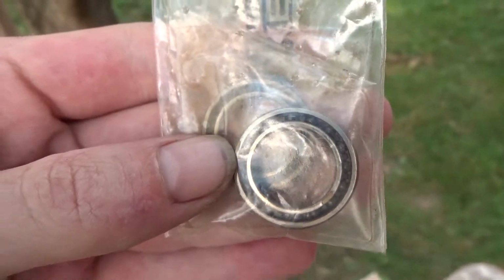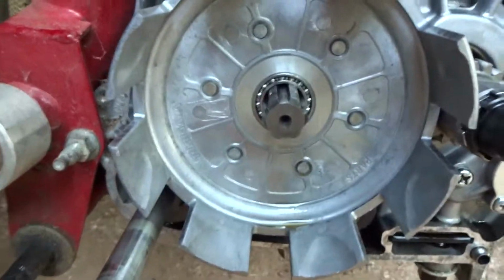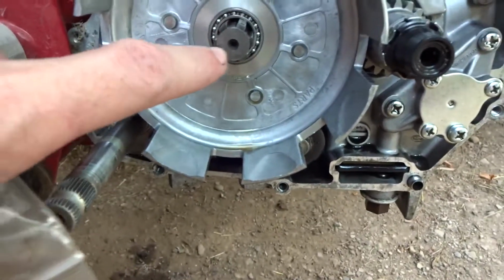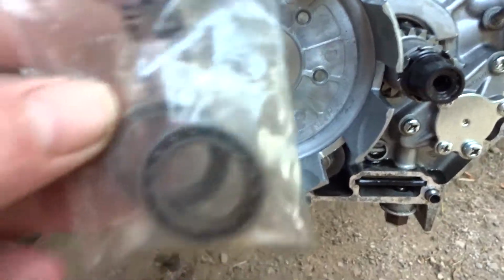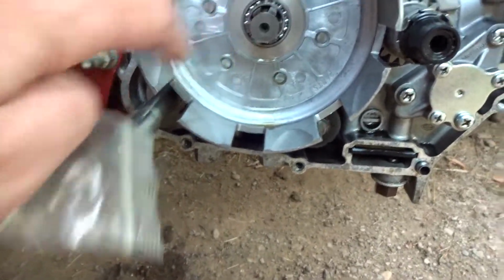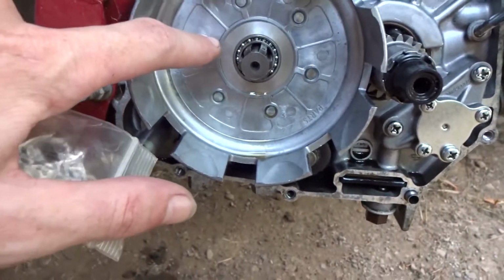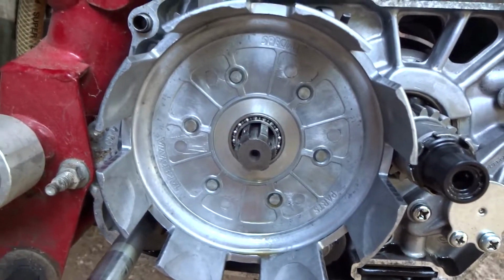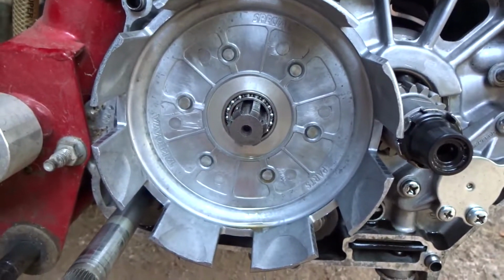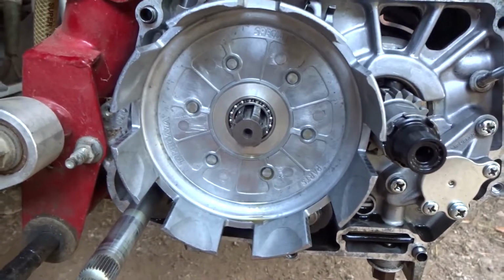I would have rather had this shaft that's here, the transmission output shaft, be like 3mm smaller, because the grade of this steel is amazingly strong and you would never break it. Then the bearings that sat in here would have been bigger. Or even better, they wouldn't even need to do that if they just cut out a bigger bore in the clutch basket housing to accept the larger bearing. One crevice I didn't really like about this.